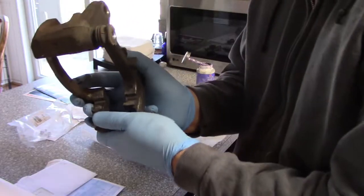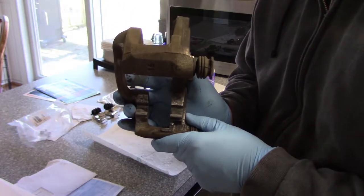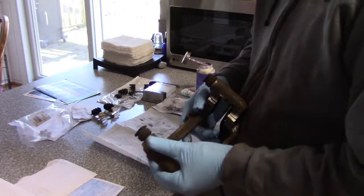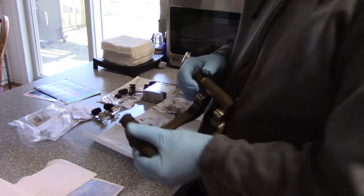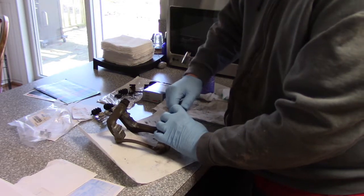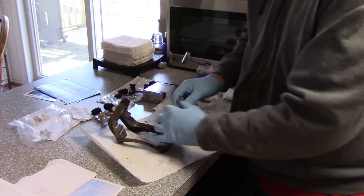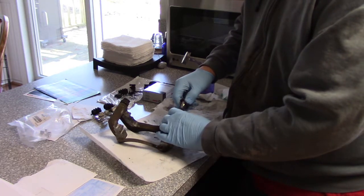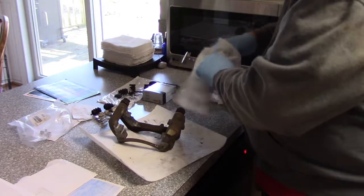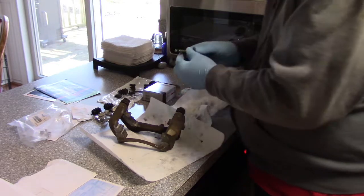Let me get a good picture. You see it's nice and shiny. Now I'm going to work on the pins, and depending on the model, some of these pins differ. We'll take this one, we'll just make a good guess. One has a band around the end. Glad I did get that kit with the boots, because this one is torn. There we go. This one happens to have a pin, so don't forget a band on the pin.